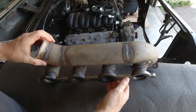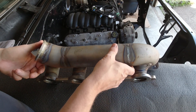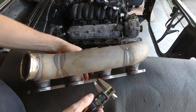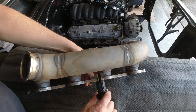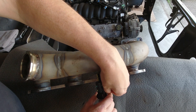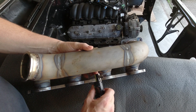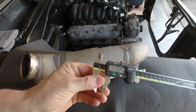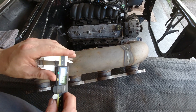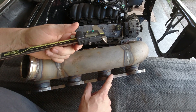The quality is very good because it's all done here in the U.S. I think he's a one-man shop — he does all his own cutting, welding, and piecing it together, and really puts together a beautiful product. On very cheap headers or turbo manifolds, if the header flange is really thin, that's where you'll get exhaust leaks — there's not enough material to hold it all together structurally. The thicker the header flange the better for sealing, and these seal up absolutely perfectly. He's even gone with a slightly thicker flange on some of his newer stuff.